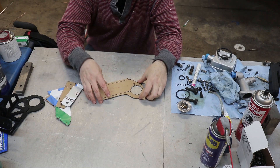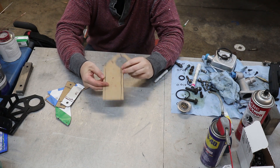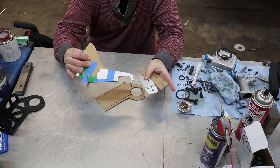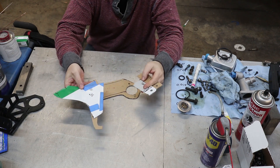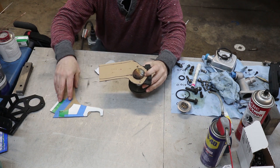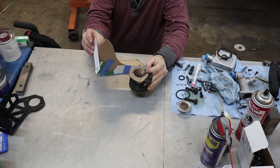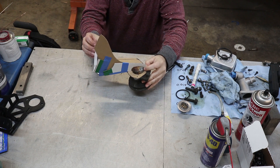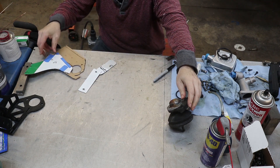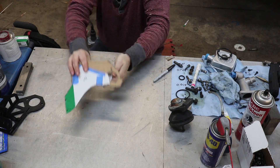As I was figuring out how to make the engine mounts, I started working on the passenger side engine mount. I made a whole bunch of cardboard templates, cutting and taping stuff together, measuring angles, trying to figure out how I could go on top of an engine mount, brace and triangulate, and bolt to the block. Using my cardboard templates I was able to rough up a design.